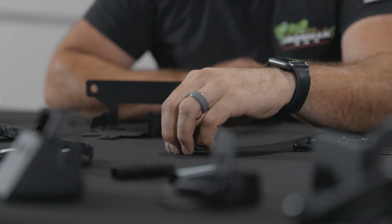And then get yourself a drill bit and see how this just dips right down here. Right in the center, between that and that, right in the center here, we're gonna drill a hole right up on the underside where we can plug this back in and just relocate it off to the side. The reason why it's gotta be here is you have a welded rib right behind here, and then you've got some more support stuff here and here, so. Push that back up in there. Ooh, that's better than what Ford did.